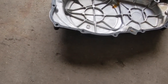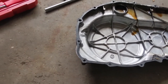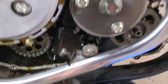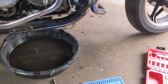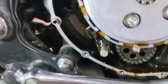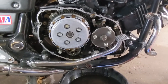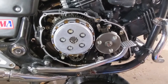Haven't pulled the gasket off yet. It looks like someone's been in here before because it looks like it's been RTV'd a little bit. Some of the bolts I could tell were either already snapped off partially or they snapped on me, but I think all of them are long enough that I'm not going to try and get those out of the deep holes yet.